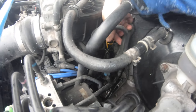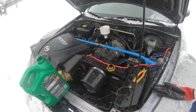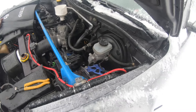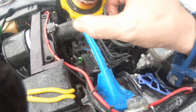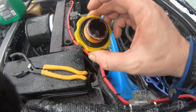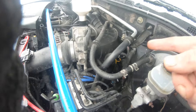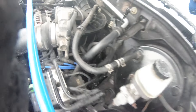Something to check for in the winter — your dipstick. Sometimes you can pull it out and it'll be a little creamy at the top, and you'll think 'uh oh, coolant seals.' But that's not always the case. They do build up moisture, especially in the wintertime, and especially if this rubber seal and your oil fill cap is non-existent, cracked, or ripped. Moisture gets in, sits at the top, works its way up the dipstick. So just a couple of things to check for.